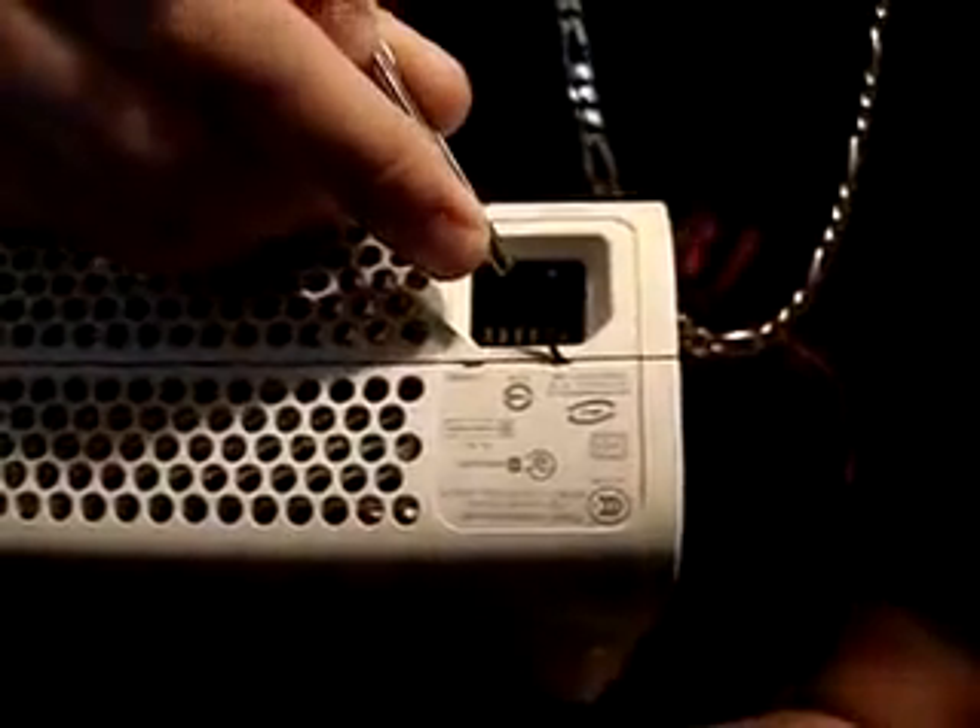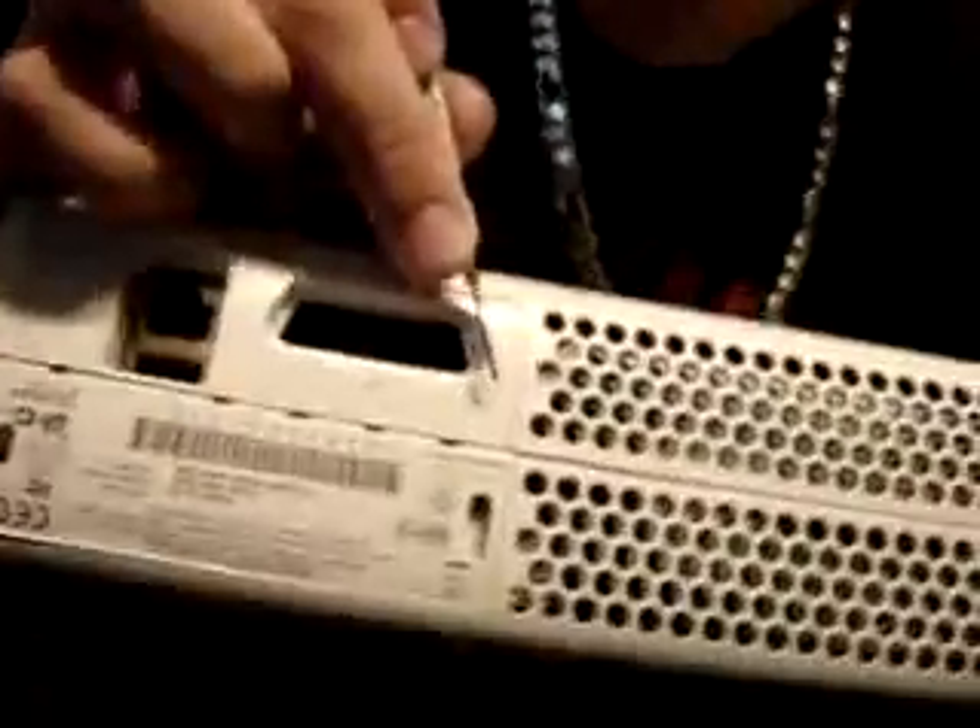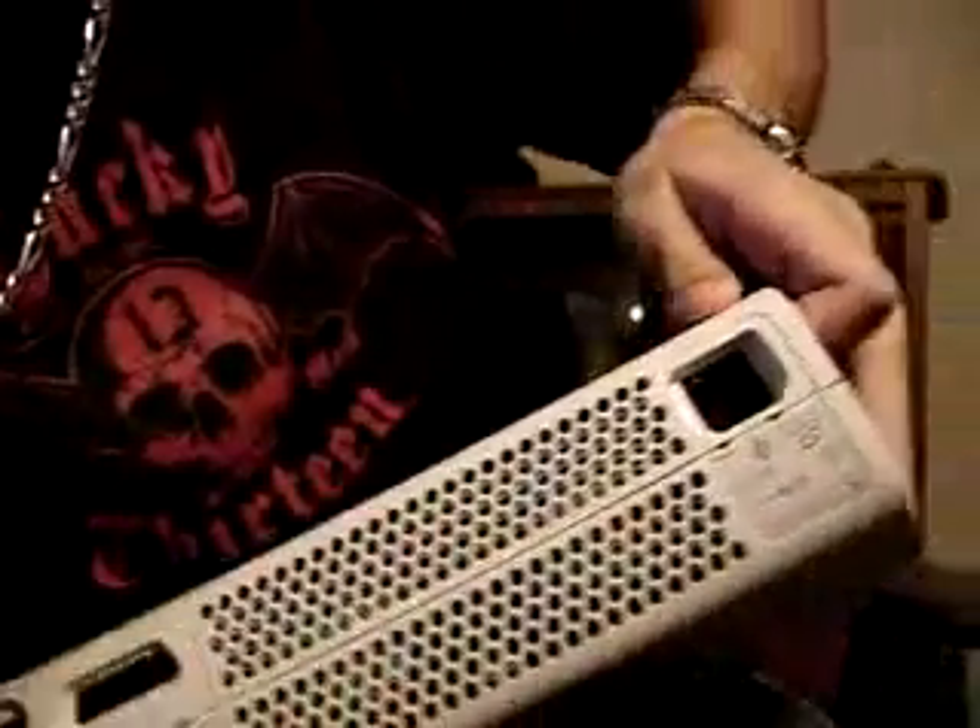To get the back off, you will see two very small holes right here and five back here. Some people have a lot of trouble with this, but all you need to do is stick your screwdriver inside. When you hear a popping sound, that means they come off. Then go to the other side and do the same thing. Sometimes they re-pop on and you have to do them again.